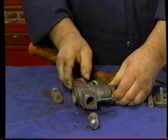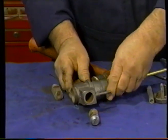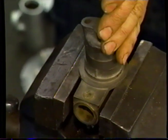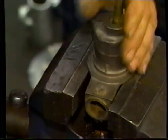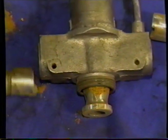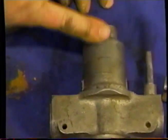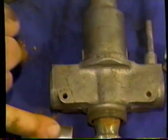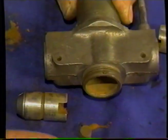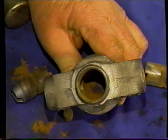And there. I'm going to now push, hopefully, the piston out from the back side. You can see the ramp that pushes the expander with the roller there, which causes that to do it. So you've got a hydraulic pressure on a cup seal, which pushes the piston, which sends the expanders out. So we'll look into that now. You've got a real mess inside there, you can see. So you're going to have to dig at that rubber to make it come out.